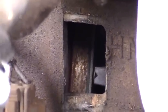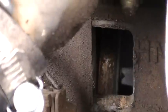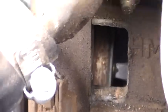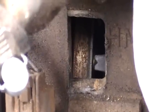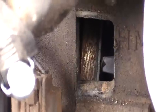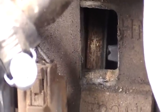if I could hand turn over, you're going to find three marks grouped together, and then another mark off behind the three marks. So it'll be three marks like here, and then a mark back here. Now the one back here should be red, and the three marks here should be white, and you want the center white one. Now, when I start the engine, obviously they'd be flying by so fast you couldn't see it, but that's where your timing light goes on, because it flashes right at the precise time that the number one spark plug fires. You should be able to see just that mark on the flywheel. So it's kind of an optical trickery thing, the way those timing lights work.